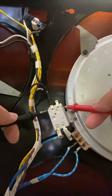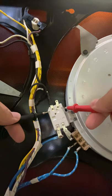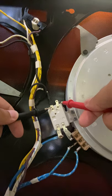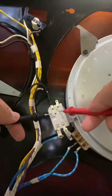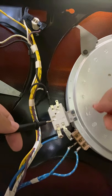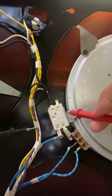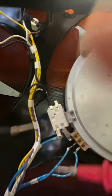So if I test this, I should get either an open load reading on the ohm meter or no beeping sound if testing for continuity. I should get no beep when I touch the contacts. I just got a beep, indicating that this switch is closed even though I don't have electricity or heat going to the element. This tells me that this switch is stuck - the contacts inside the actual switch have fused together. This is the bad switch.